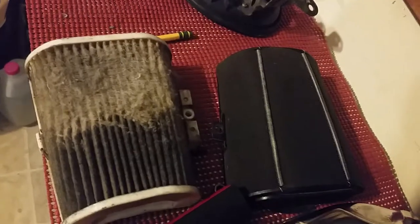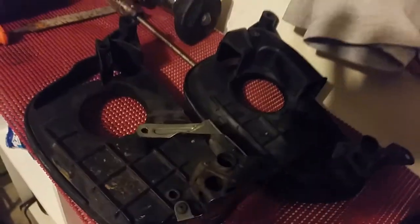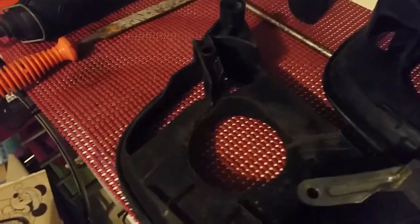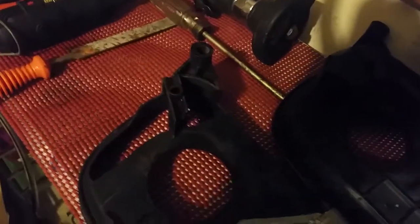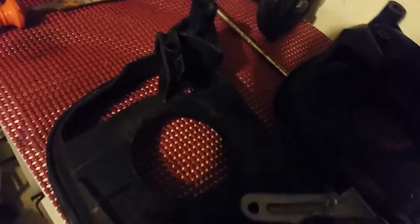They are readily available, and that's all I did. I left the whole air filter assembly together on the back side — I didn't drill holes in the front. You can drill holes in the front chrome cover, but the problem is you'll get water coming in from the rain. This still draws air through the back. While it's drawing air through the back you're not going to get water in it, and that's a nice thing. Going down the road the air filter is still sucking in more air than it would with the original style, and you're still protected from water.